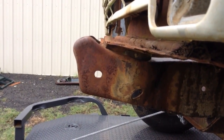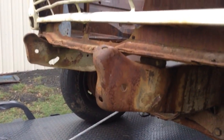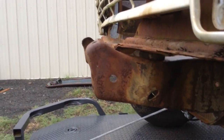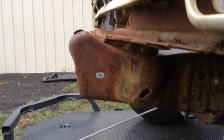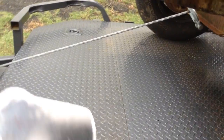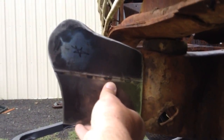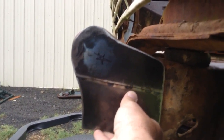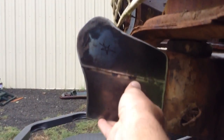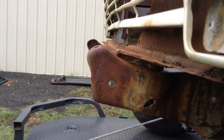On your 67-72 F-series truck you have these horns on the end of your frame which your bumper mounts straight to. There's no support brackets or anything — that's literally what your bumper mounts to. So what I did is I created these plates, four of them, and what they'll do is they copy that shape. And what I'll do is make little box-in plates to attach to the Grand Marquis.